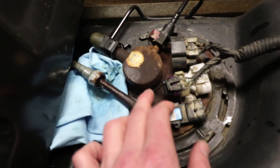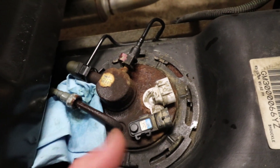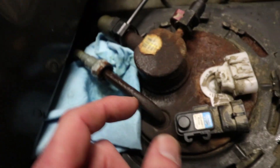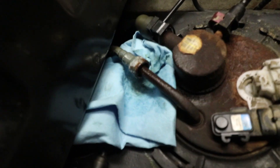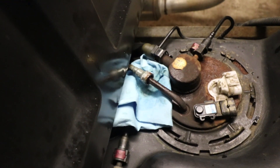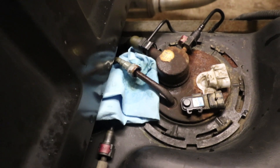I got the pump all cleaned off. There's a bit more surface rust than I would like, so we may just have to end up swapping out and getting a new housing anyway. I got all the plugs disconnected and cleaned everything off really well with the air compressor. I've been having a problem with this one fitting right here — it is seized, it was full of dirt — and we've got a bunch of rust holding that on. So I've got WD-40 soaking in there; hopefully that'll help release it. I think this is one of the only years they used a metal fitting there — it was 04 — so we're just going to let that soak and hope for the best.